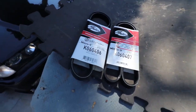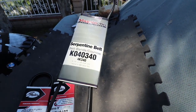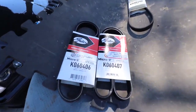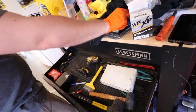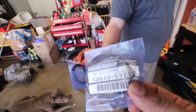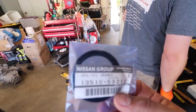I'll find out which belt size is best and let you guys know. I tend to always buy Gates belts. The Mastercraft one I think is for the G-spec water pump pulley, but I don't think I'll be running that — the one I had in there is pretty new. So far I've already taken the crank pulley off; it's quite simple but quite dirty down there. I have an OEM front main seal — I brought two just in case. Use OEM whenever you can.